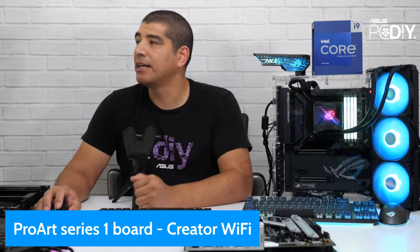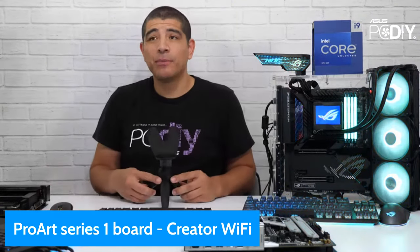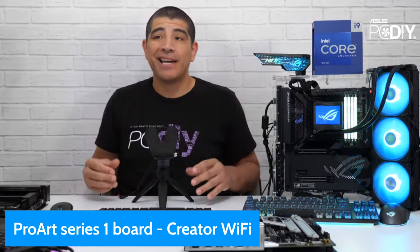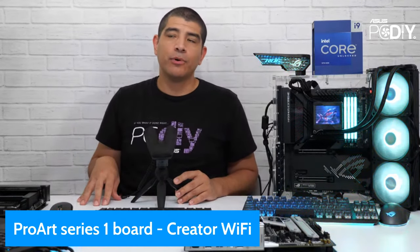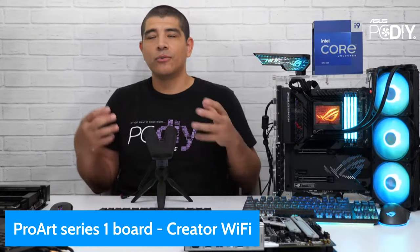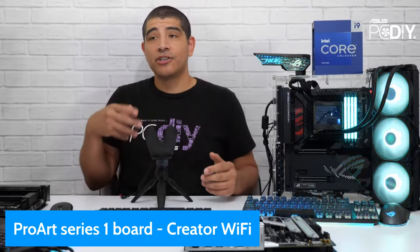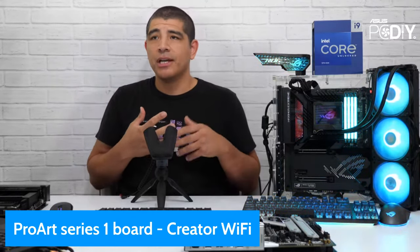Okay, I don't actually have one that I can show you, but with Control Center Express, you have an out-of-band management option available, so that you can have low-level access to the motherboard. If you were rendering or doing something on the system, you could walk away, then open up a web browser and see the system in terms of its temperatures and its loading policy.